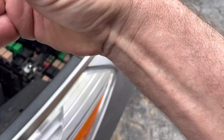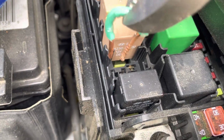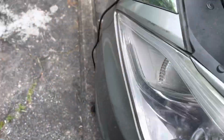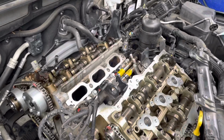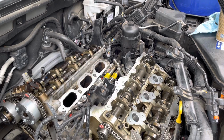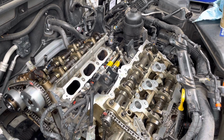And I'm sorry about this brake here, but this is what I used to bump the engine. Now the engine's apart, so I can't bump it right now, but all you're really doing is taking this little jumper and sticking it down in those two holes right there and touching those in just for a second, and then the engine will crank for just a second and break that bolt instantly. Otherwise you would struggle. I tried with an impact wrench, it did not work. And you can't turn the engine backwards. You shouldn't, is my understanding.